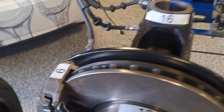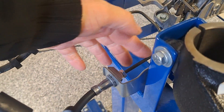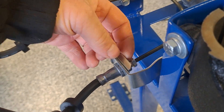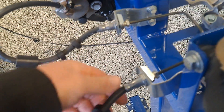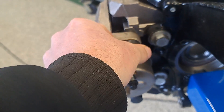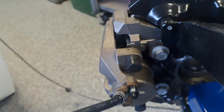Going into that front caliper, we've got this flex hose coming off of a steel line. The steel line goes to a bracket like this and has a little horseshoe clip. To change the flex hose you'd unthread the fitting and pop the clip out. Right here threads into the caliper — here's the bleeder. These bolts under the covers are what we call guide pins: it's a bolt but also the slide for the caliper, and those need to be lubricated.